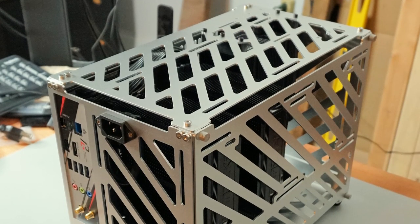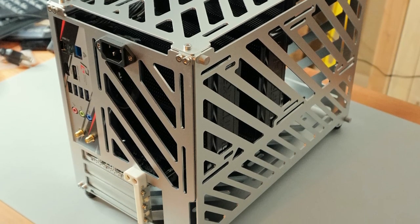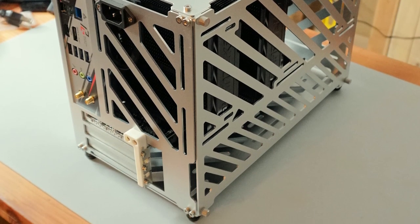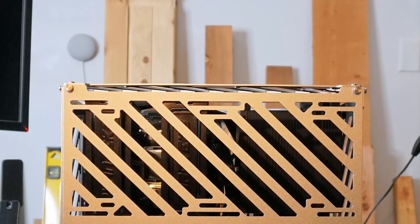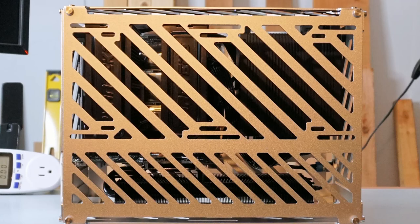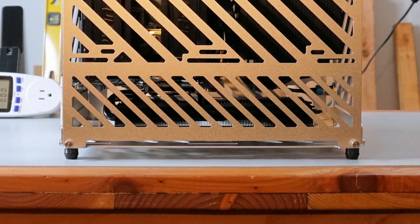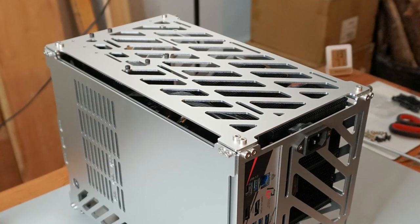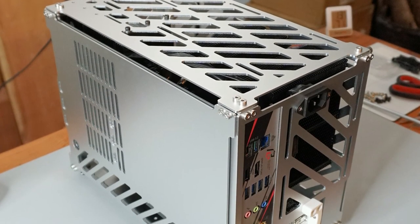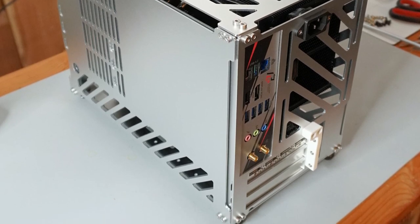In conclusion, the SpyLabs Jack-of-All-Trades is a great small form factor case for passive cooling with a large CPU air cooler and an aftermarket GPU cooler. It's about the closest you'll get to the natural ventilation of an open-air system, with the protection from damage that is not possible with an open-air system. With the right CPU and GPU coolers, you can adequately cool up to 75 watts from the CPU and GPU 100% passively.